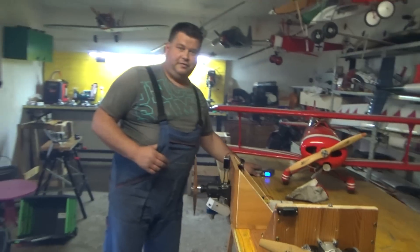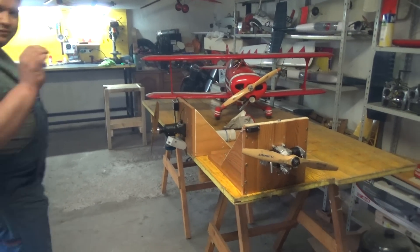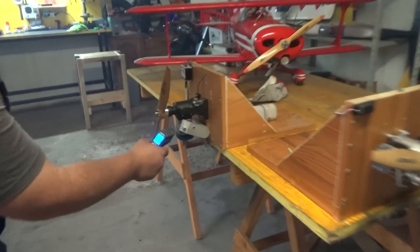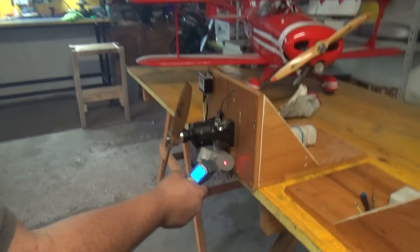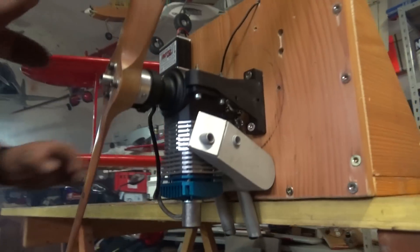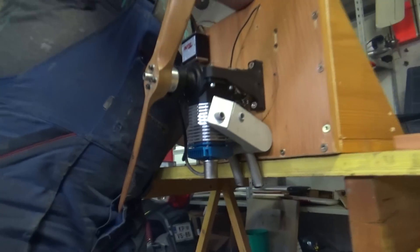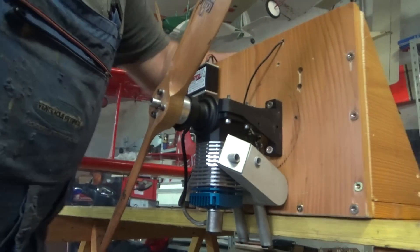We will convert this to gas - and just for a sneak peek: exhaust 14 degrees Celsius at 15 degrees ambient, so this is also a cold start. This looks pretty familiar to me - this is a Roto 25cc two-stroke made in the Czech Republic. The ignition is live, choke on, stand back.